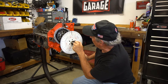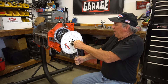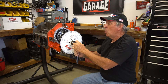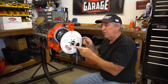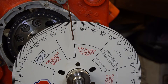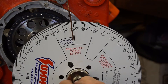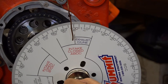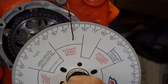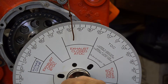Here's top dead center, and rotating one direction we read about 48 degrees, then it stops at 46 degrees in the other direction. So we're only about 2 degrees off. We split the difference — move the wheel 1 degree — and it should read 47 degrees in each location. We've loosened the knurled wheel and moved the degree wheel until we split the difference between the two readings. Now we double-check: one position reads 47, and moving it the other direction it reads the same. We're dialed in — within probably half a degree of where we need to be.